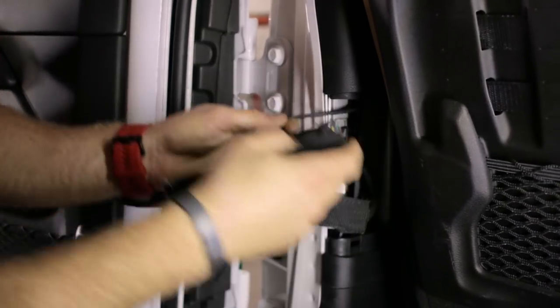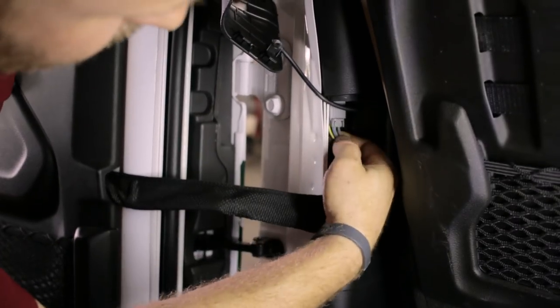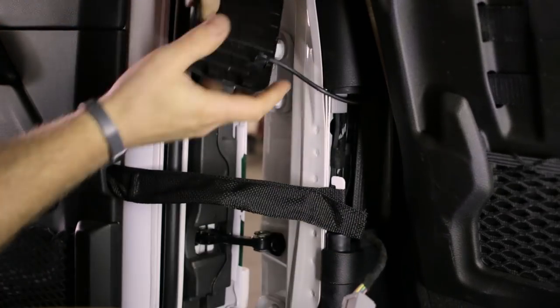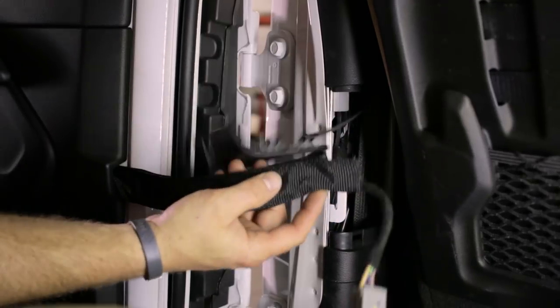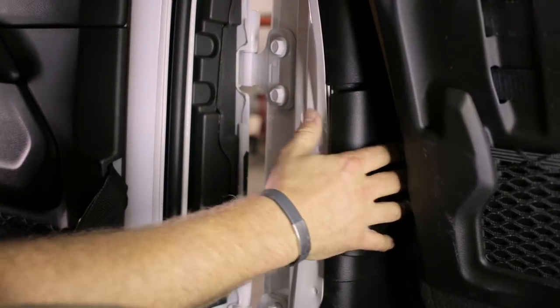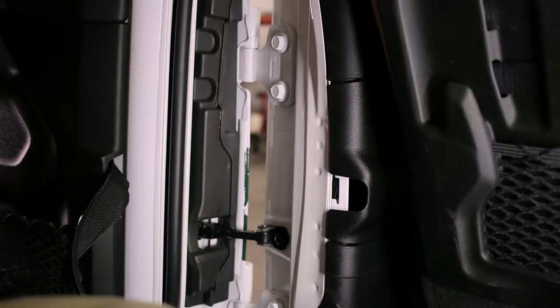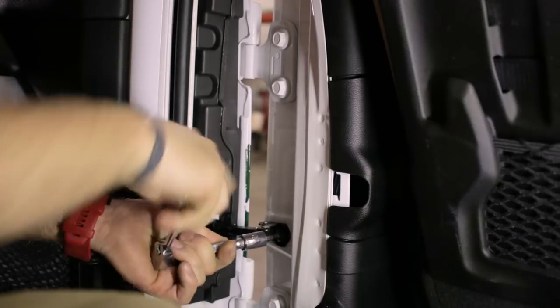You can see here there is a clip for the wiring — no safety clip — just go ahead and push that gray button down and pull straight down. Same deal: pull the door a little bit closed so you can pull the webbing up off from there. Replace this plastic piece and then use that same T40 to remove this inner door stop.